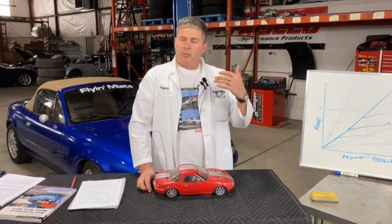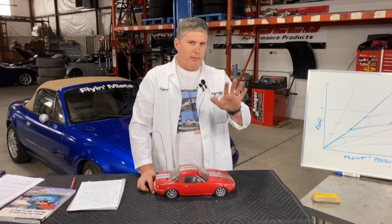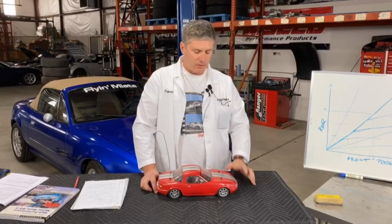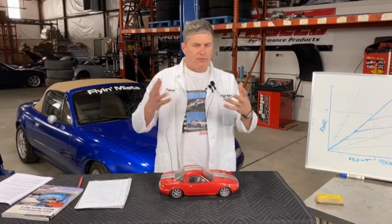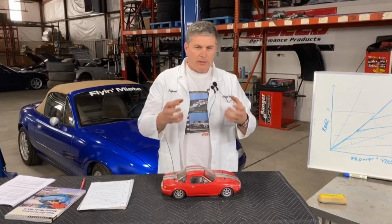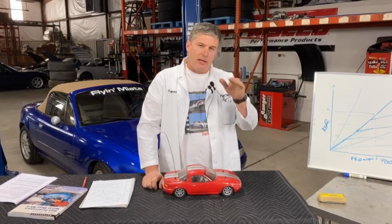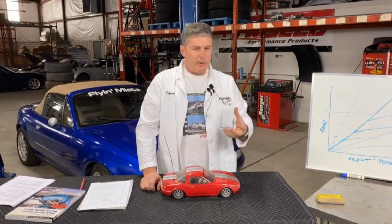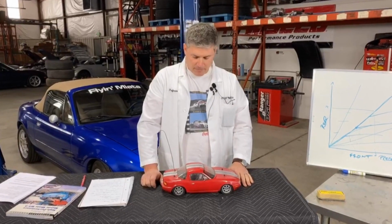So the purpose of modulation, especially on cars with ABS, is the ability to keep the brakes right at that threshold of lockup, right where about 10% slip, where you get the maximum traction. And if it's difficult to modulate because you've either got a big floppy caliper that's got springs in it, or feels like it's got springs, or you've got a really, really grabby pad, you can find yourself having a hard time staying right on that edge of lockup. And so that modulation becomes important. That's where a very grippy pad, a very big rotor can actually be detrimental to your braking distance.